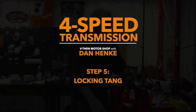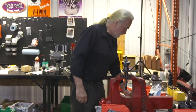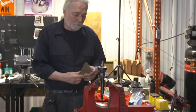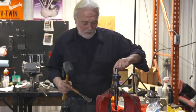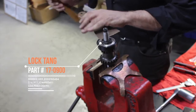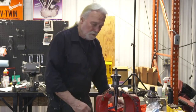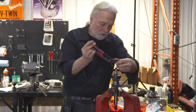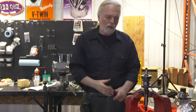Okay, so we're now gonna lock our tang. Again, we locate in the soft jaws so you don't injure our main shaft. And with an appropriate tool, it can be a gasket scraper, a small sharpened chisel or whatever, we very carefully locate the lock tang we're gonna utilize, lined up with the flat. And so we don't mar things all up, we just carefully locate, as you can see, and roll it forward, neat and clean. Now we adjust our channel locks to the proper dimension, quite large here, and we'll come in. And nice and clean, we roll it in against the flat, and that's it, and we're done.